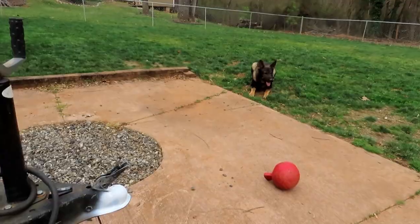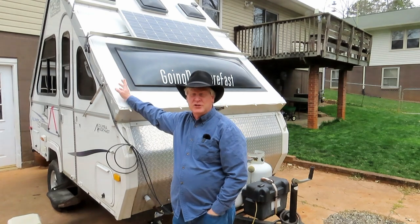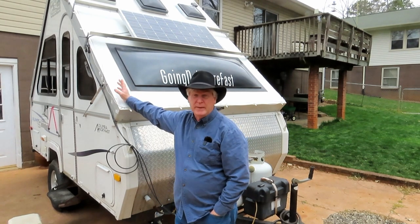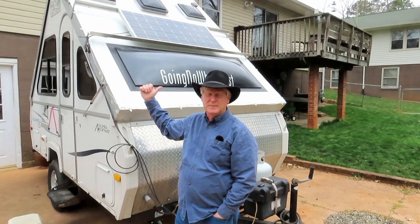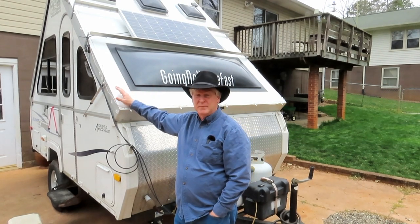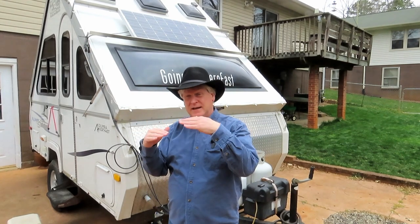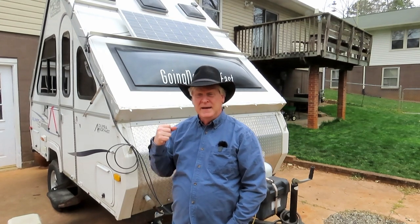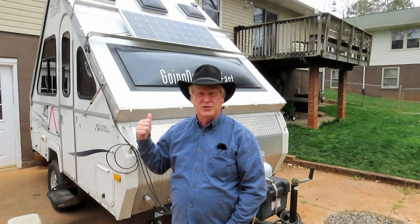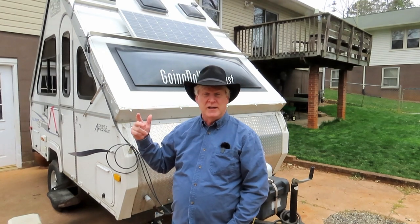When I changed the battery I also put in a solar panel, which was pretty easy. I'm going to upgrade to bigger solar panels and I've got some lithium batteries coming. The problem with lithium versus lead acid is that the trailer isn't set up for lithium. Lead acid batteries need to be floated and trickled, while lithium batteries you can pound 10–20 amp-hours in at a time — they recharge really fast, but you need the right charger and converter system.